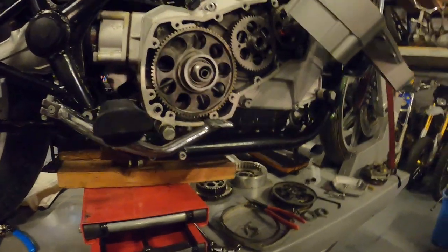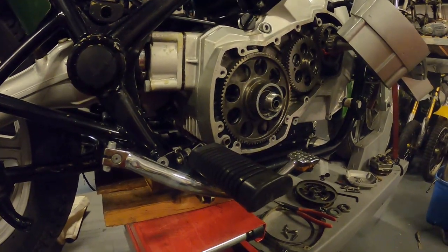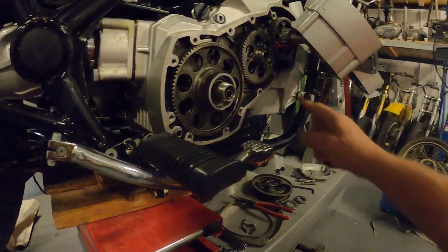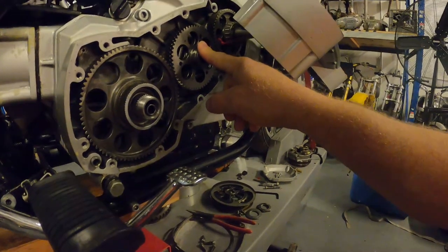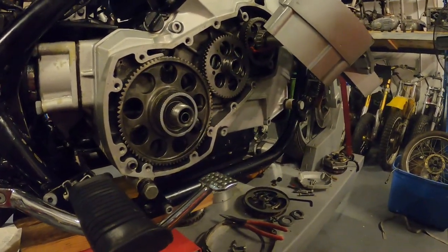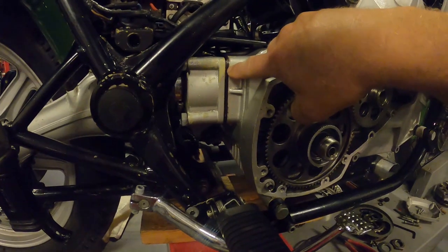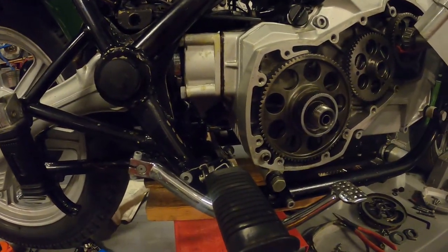So I went back through my documents before tearing it down further — we don't want to do any harm. I found a letter where they were requesting parts: the helical output gear. The response was it's a match set. I thought maybe they meant the output gear here — this is the output gear from the engine. This is an idler gear slash starter clutch, here's your starter, and here's the input gear for the transmission. We can see they were in here because there's orange goo. I'm expecting they meant the output gear for this drive shaft output from the transmission. That all turns freely and nicely, so let's hope that's correct.